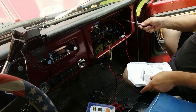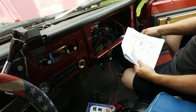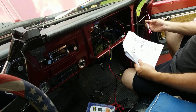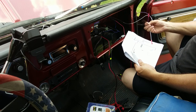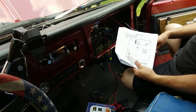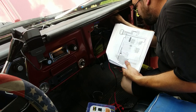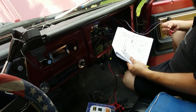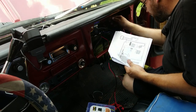That's interesting. So it shows two wires coming out of this relay going into a single heat shrink, as we have here. But then only the white wire is continued, and it goes to the high-low pressure switch. So what is the purple wire for? It's just like the normally open or normally closed part of the relay. 1, 2, 3, 4 wires going off that relay. Well, those come out of the same pin, the white and the purple. So I would assume we don't even need the purple wire, because they're coming off the same pin.